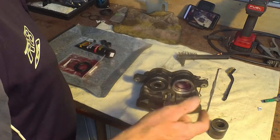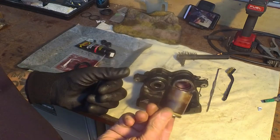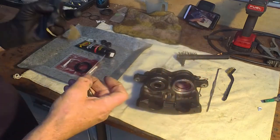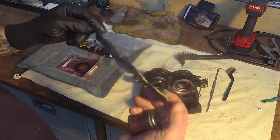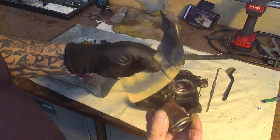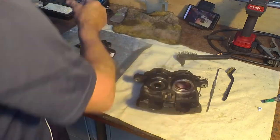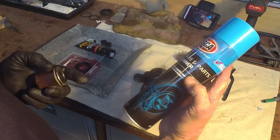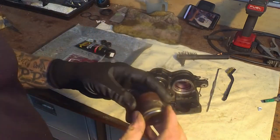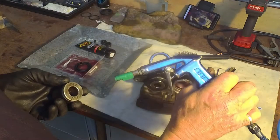When you pull them apart, you may as well give it the full rundown. I haven't bought new pistons because these pistons are actually quite good. When I pulled them out they looked good. I put them on a wire wheel to clean them up, then used some 1200 grit sandpaper wrapped around them and gave them a good twist. Clean everything up with brake and parts cleaner - without the rubber seals in, don't do that with your seals in.